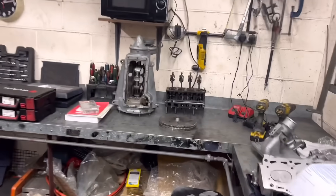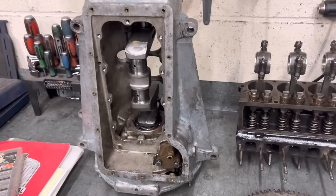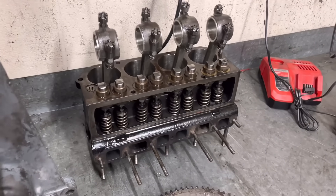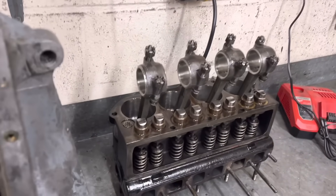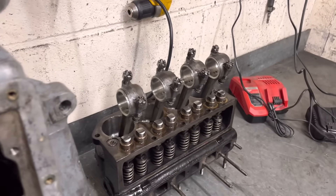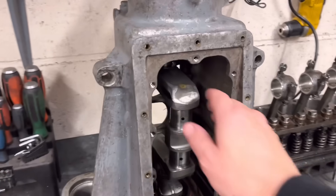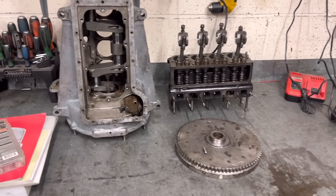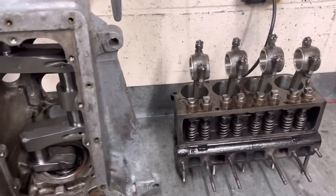Do you remember a few weeks ago I said that John, who works for me here, has got a little Austin 7 Special and he blew it up? Well, he's been in the process of doing the engine and here it is. Tiny little things — 750cc. You've got the barrels here, which have all been done. He's bored those out, I think they're at plus 40 now. He's gone for an uprated Newman cam on this. You can see the rods — look how diddy those rods are in comparison to my hands. They've been off to John Kirby to be white-metalled, he's redone those. John's ground the crank — absolutely lovely, and you can see that is in there and turns a beaut. He's been coming in at weekends to get this one done. We'll head over there when he's built it and watch him put it in the vehicle. Lovely little motor — to be honest, absolute bloody death trap, but as long as he enjoys it.